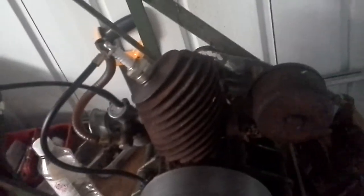So I should have checked this first really, and it would have saved me all the work of removing the flywheel. Anyway, I have replaced the HT lead and it has now got a lovely spark.